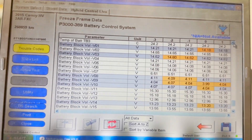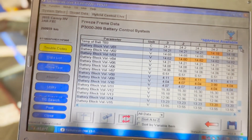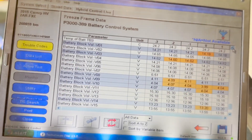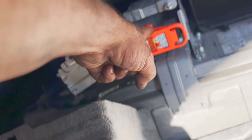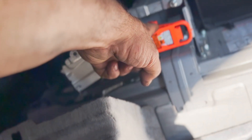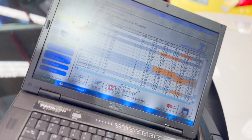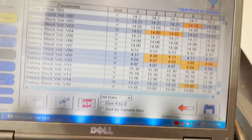But if one of the block voltages goes below 10 volts, the car is not going to start. So if you want to go overseas and park a hybrid car for three or four months, it's better to remove the battery terminal. I'll show you where the battery terminal is — take off this terminal, and it's best to take off the hybrid battery high power connector as well. Leave it as long as you want, and when you come back just connect these two plugs and you are good to go. But if you leave both plugs on, this can happen to you as well.